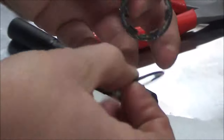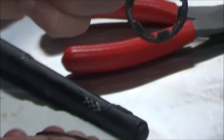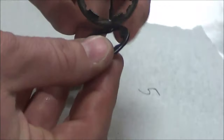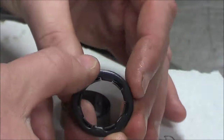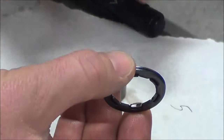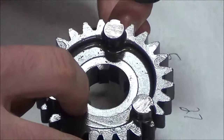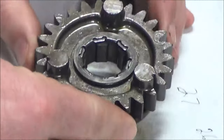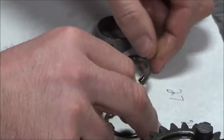The other thing we're going to notice is these thrust washers — a nice flat side and a more rounded side. I really want you to focus on these tabs, because what happens is this engages into the washer and creates a lock so the shim can't spin around. Also look at what the parts ride against. Notice this gear has a machined area — that's machined, not wear. The whole reason for a machined surface is so that oil can get behind there.